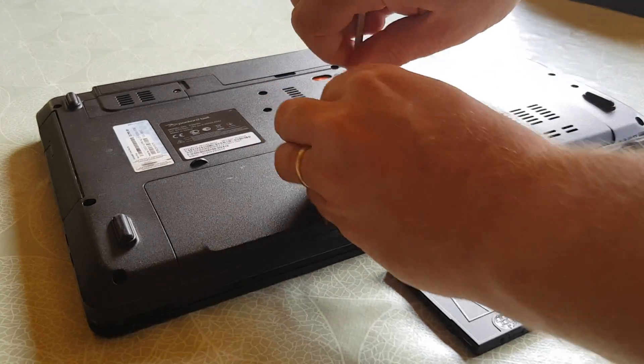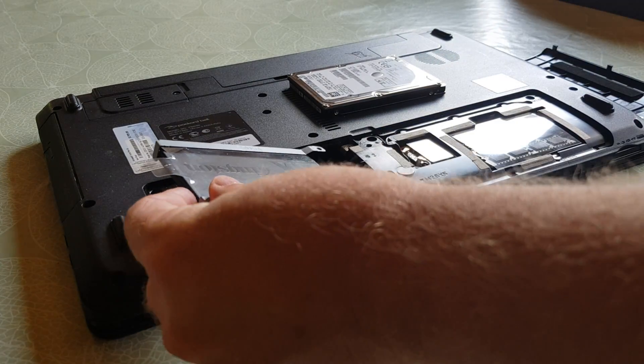Let's start with step one. Changing the hard drive is relatively simple. First of all, if there's any data on the hard drive that you need, you need to back it up — onto a USB flash drive, over your network, whatever — because once you take out this hard drive you're not going to have access to it. Having done the backup, you simply take off the cover. Most laptops allow easy access to the hard drive and RAM just by taking off a plastic cover with one or two screws. Take off the cover, you'll see the hard drive. You can just slot it out, put the SSD in the cradle if it has one, or just put it in its place.